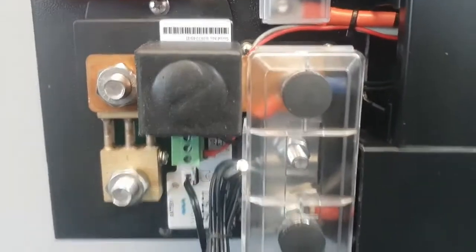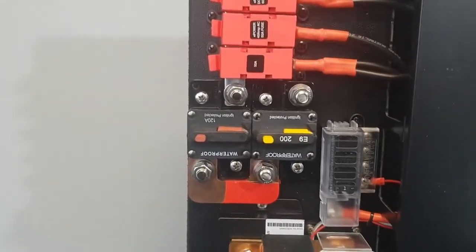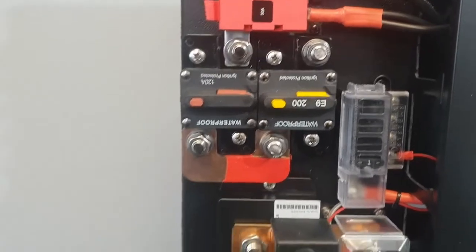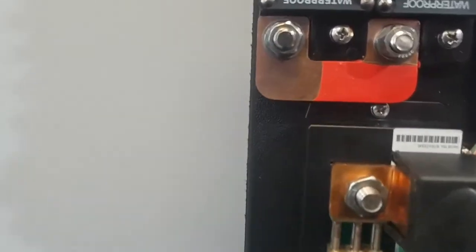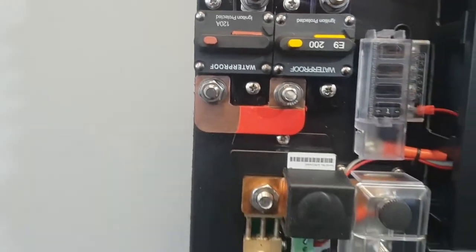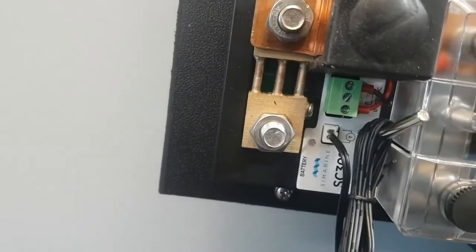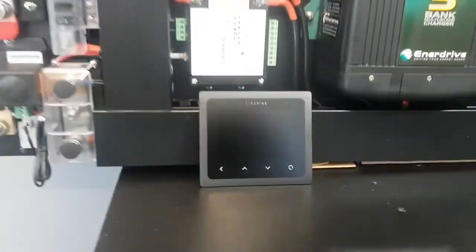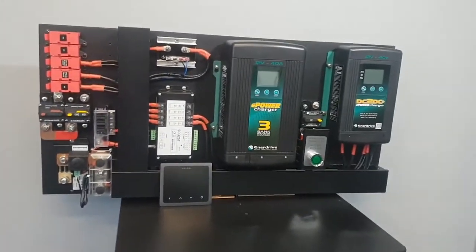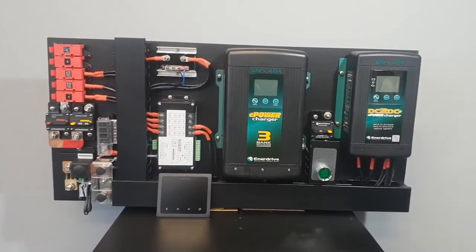You have two spare fuses ready for additional loads, and every single negative feed connects to the bus bar down here. It's a very simple installation. You can connect your inverter to the 200-amp breaker, your main battery positive feed goes on the bolt at the bottom of the 120-amp breaker, and your main negative feed from the battery connects at the bottom on the shunt. Run your data cable, mount your display, and you have a premium system suitable for any lead-acid or internal BMS lithium battery.